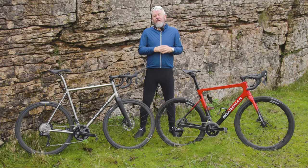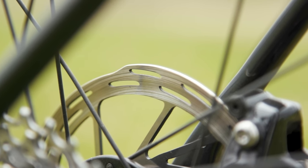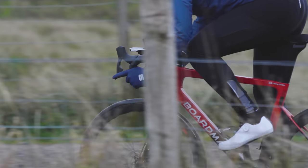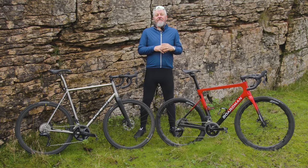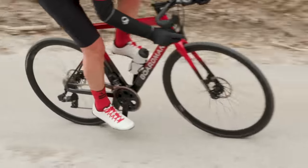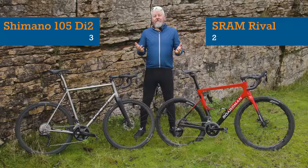For Rival, the comparison is much simpler. In terms of wear, the brakes have held up very well — there is a little light scoring to the paceline rotors, but there hasn't been a change in feel. The brake feel is excellent; combined with 160mm front and 140mm rear rotors, they're packed with power yet have enough feel to avoid locking up a brake in wet or frosty conditions. The rear brake has been flawless, though I have noticed that on particularly wet rides, the front pad and rotor do get a little vocal for the first few kilometres when I next take the bike out. Shimano 105 Di2 just wins out when it comes to braking. Head-to-head scoreline: Shimano 3, SRAM 2.